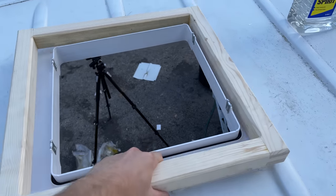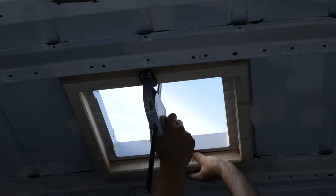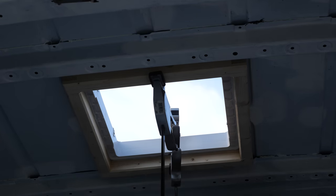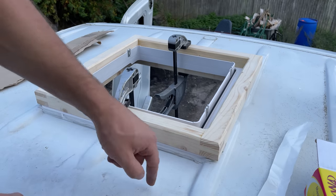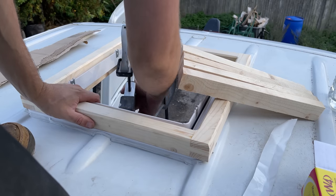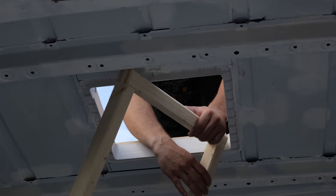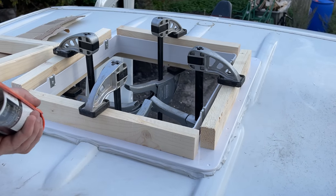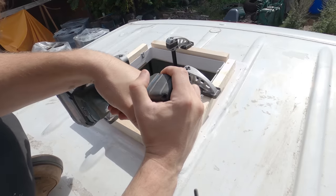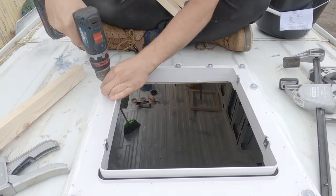I needed to go inside to get it lined up properly. I'll need to run a bead of Sikaflex here because of those ribs preventing it from bottoming out, but it looks like I've filled the gaps quite nicely — and there'll be screws pulling that down into the mastic. I didn't have any self-tapping screws ready, so I popped the second frame on top to apply even pressure from outside while the frame below was held from inside. Using shorter bits of wood gave me clearer access to the outside of the flange to seal it while being pushed down by the clamps — I actually heard pops from air bubbles working their way out as the mastic got squished down. I then went back with Sikaflex to smooth it all out, piloted holes through the flange into the frame below, and screwed in.